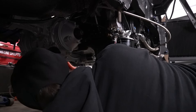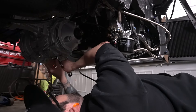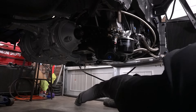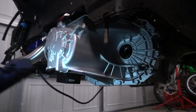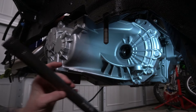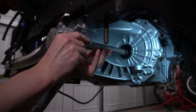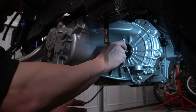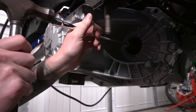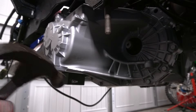We're gonna crawl back under the car and tighten everything down. The transfer case bolts go to 51 foot-pounds plus or minus seven, so we're gonna do 54. These are definitely 17s — boom, we'll get the paint pen and mark all those done. Now I'm gonna hang the light and go ahead and put in this output shaft — making sure we got the right end, the one with the bolt that's able to thread through it — and slide this guy through. The light died so we had to max out the ISO on the camera, but that output shaft is all the way in the transmission.